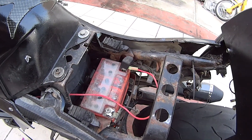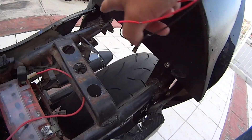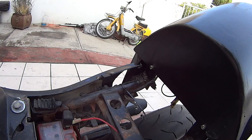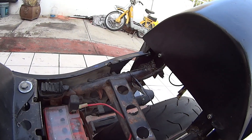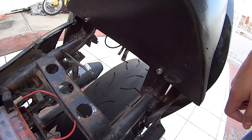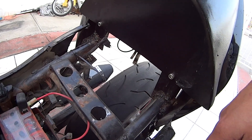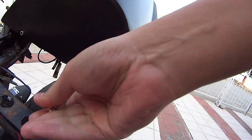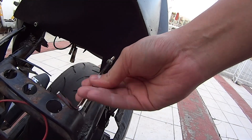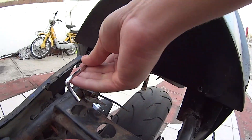Now we're on the bike. It just requires power and ground. I'm going to put it in the back of the fairing and remove these two Allen screw head screws. I'll fix it with some double-sided tape. Keep in mind you have to put it underneath plastic, not metal, because you want the cell phone signal to pass through.